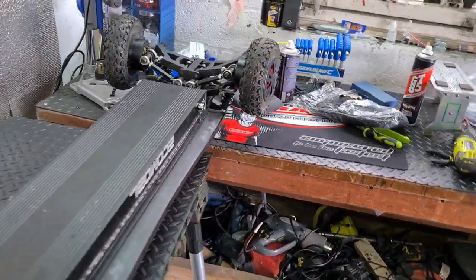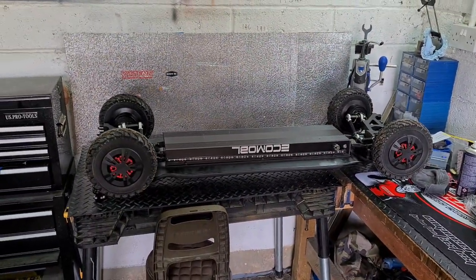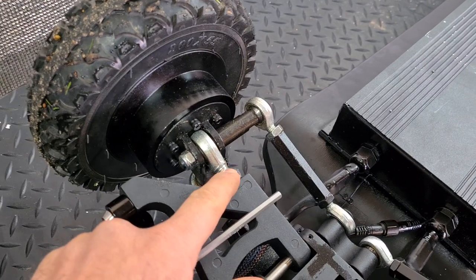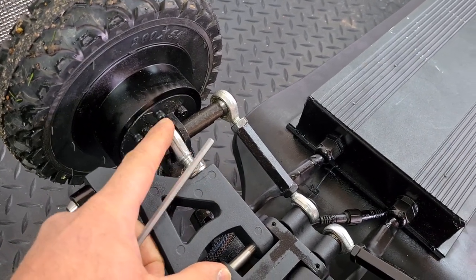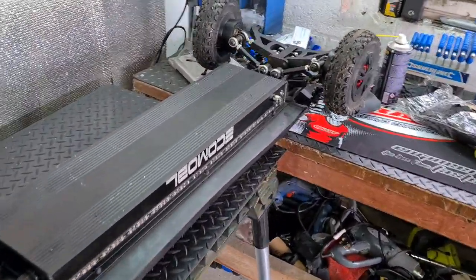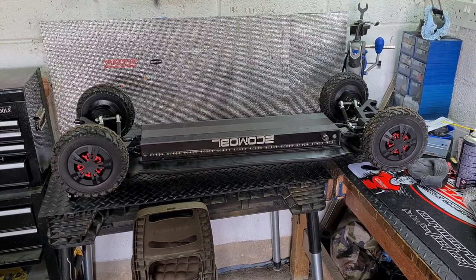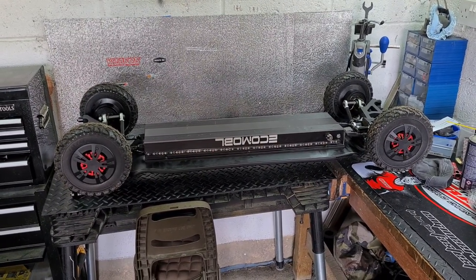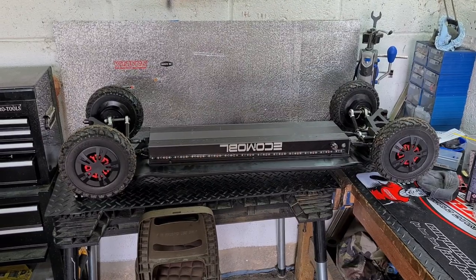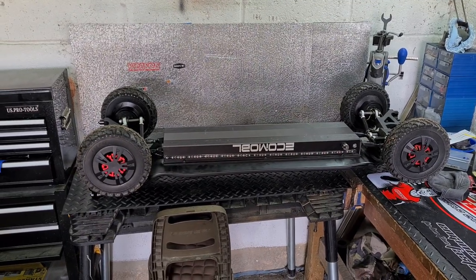This is just the same as any other vehicle — it needs to be tuned and checked over. I'm glad I did check it over, because some of these had backed out. If they do back out and there's a lot of movement going over rough stuff, you'll damage the threads. All the threads are fine now; I've tightened them up, and after every decent ride I'll do a quick visual inspection of those nuts on the eye bolts. That's what I wanted to share. I'm going out for a ride later — the sun is out, maybe I'll film it, but I will be filming soon. Peace.